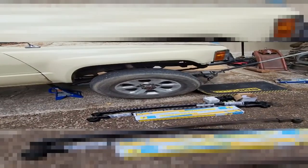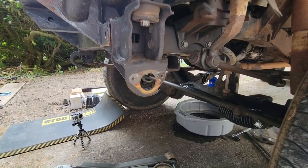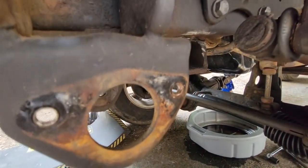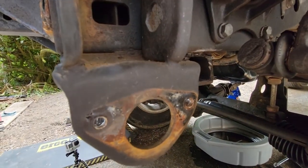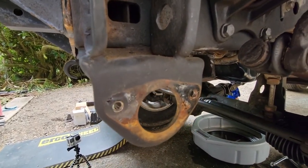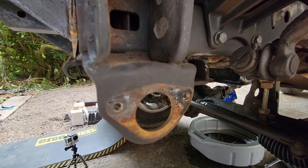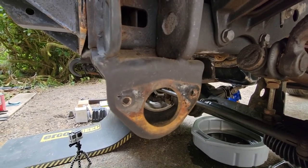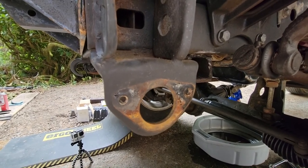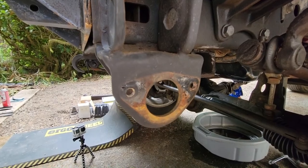All right. Well, I got the broken bolt out. I don't know if you can see those, but the threads are kind of screwed up. They are kind of screwed up on both of them. Hopefully I can tap it and save the hole. If not, then I'll probably just have to nut and bolt. There's enough room. I guess we'll find out. Hooray!